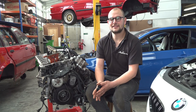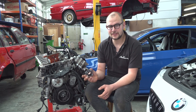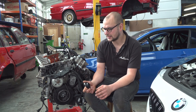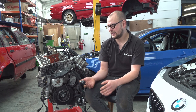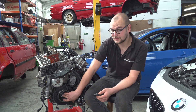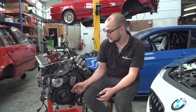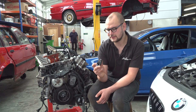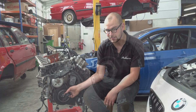There are two different stages to upgrading your S55 to guard against crank hub failure. Step one, which is quite an easy one — it's not really a full fix, but it certainly seems to help stop them failing — is a capture plate. This fits over the front of the crank across the bolt, and essentially stops that bolt from being able to unwind, which seems to be what happens on a lot of them, where it comes loose and allows everything to spin behind it. This is a KED item available on our website. It just slots over there, torque the bolts down, and job done — that bolt can't then come loose.